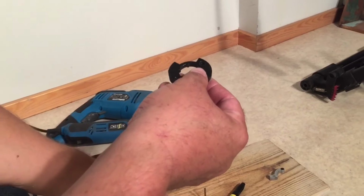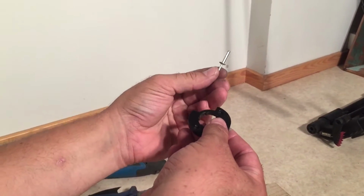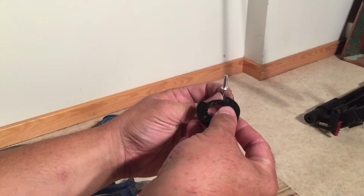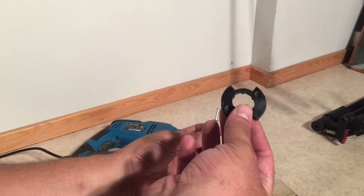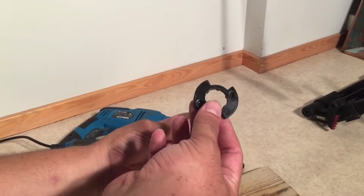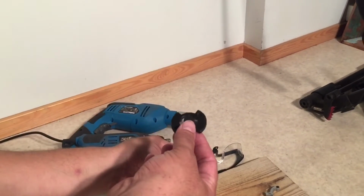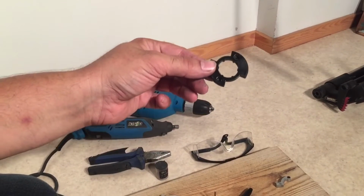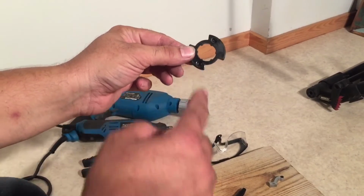So what I use when I'm repairing this is I specially cut rivets to make little plugs, and I drill out holes, and then I use super glue in order to hold them in place within the disc. And I find that this works quite nicely. It tends not to break as opposed to the original plastic discs. So that's what we're going to be doing today. So if you're with me, then what we're going to do first is drill out holes for the plugs to go through.